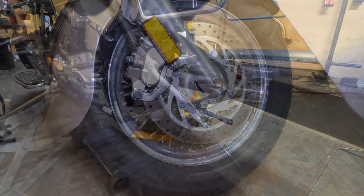I'll give you an idea of what we're doing here since I can't film everything at once. First thing I'm going to do is make sure our rotation is good — we've got a brake side and a drive side, so we're good. I'm going to show you this drum side. I usually leave the axle in it and stick that in — you've got a spacer and a washer, just stick that in. The spacer is going to go inside the frame rail and the washer is going to go on the outside. I put a little bit of grease on the splines — they were looking kind of dry. Just a little bit of grease, you don't need to splurge.